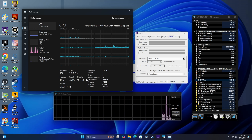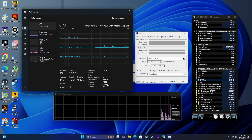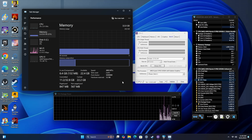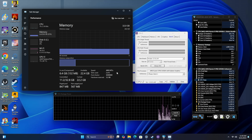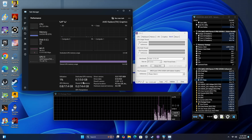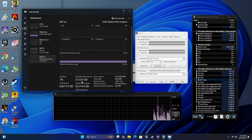Been up and running for a little while now, got everything updated, a bunch of games and applications installed that we're going to be testing out here. It's definitely a quick machine. We've got the AMD Ryzen 9 Pro 6950H, 32 gigs of DDR5 at 4,800. I personally haven't tested 5,600 in this unit. And of course we've got the Radeon iGPU. Out of the box, dedicated GPU memory was already set to 3 gigs — I'm going to leave it here. You can allocate up to 16 from the BIOS if you want to.